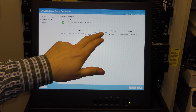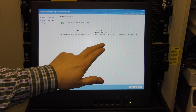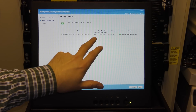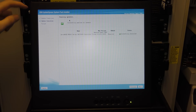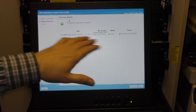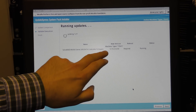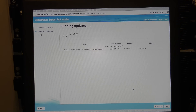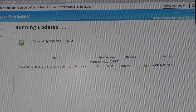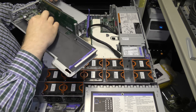I got the card upgraded to some extent — to firmware version 12.12.0. I got a failure when I tried jumping directly to the latest version, so I have to upgrade it in steps. I loaded a newer IBM Update Express and tried again — stepping through 12.13.0. Now at the last step, upgrading to 12.15.0. It's updated — all good. I'm moving the cards back now, so the M5015 can go back into the original server.